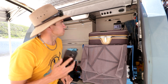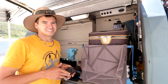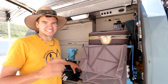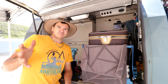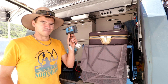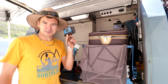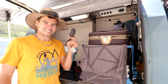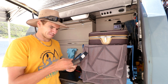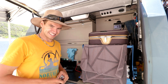I left it on a little bit longer and the iTech World panel has gone to 4.96, so pretty much 5 amps. That's still a difference of 1.2 amps. But to mix up this test even more — when you get cheap solar panels you most of the time get a really cheap solar regulator. Does it make that much difference? Well, I'm going to plug this in and see what the difference is. I'm really curious to see what this puts out compared to a really good MPPT DC-to-DC charger.